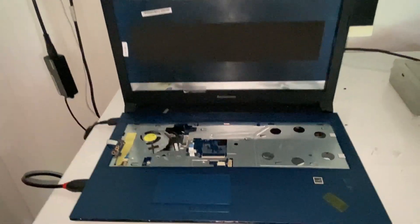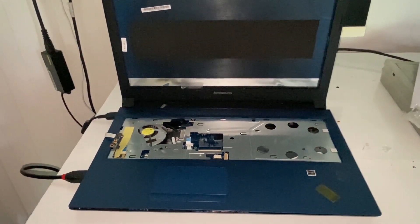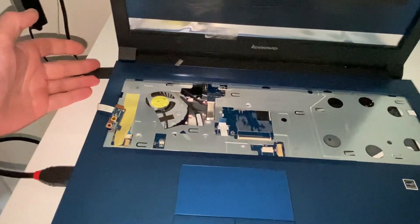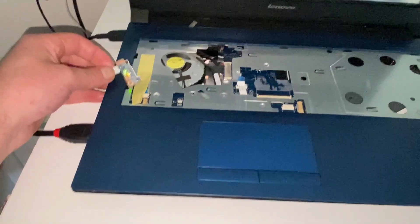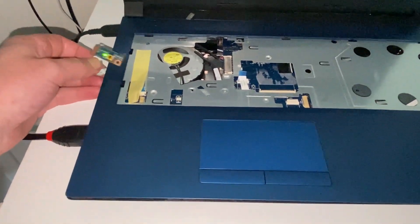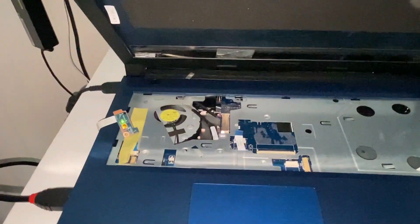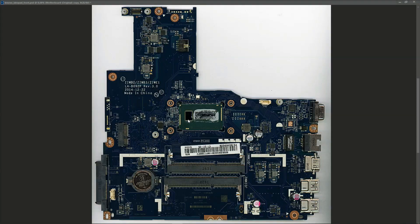This week's laptop is a Lenovo IdeaPad 305, bought with a bunch of other laptops described as having a motherboard fault. There's no screen and no keyboard, but there is a generic Lenovo charger and an HDMI cable plugged in. Pressing the power button gets the fan spinning up and the light comes on, but there is nothing on the screen. It is powering on but it won't post.